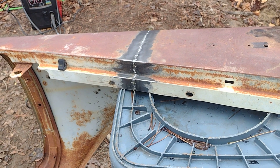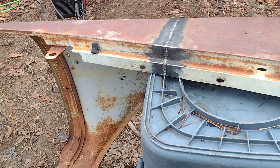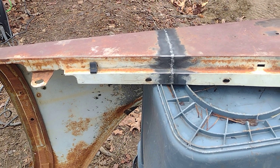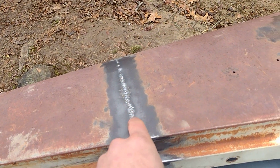The whole point of that is to put some strength back in this fender here, and that way we don't have to worry about it. But I made one mistake — I did talk about it a little bit in part three, probably couldn't hear me too well, I apologize. You always have to take into account how thick your cutoff wheel is.